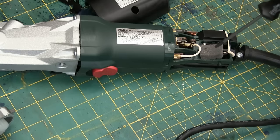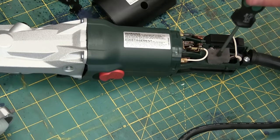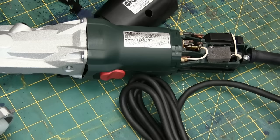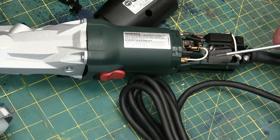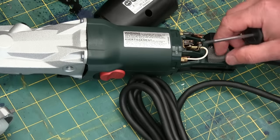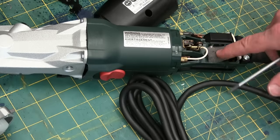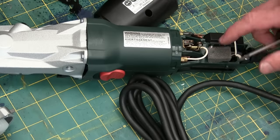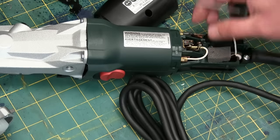This is weird though — urethane open-cell urethane foam, a little pocket of it here, just for keeping the rattle-trap effect down on the wires. But this is not very good with heat — it can't handle a lot. It's funny that it's in here right by the commutators and the brushes. This urethane is not the correct material — it's open cell, probably about 2 lb/ft³ density. It would be full of bromine, so it's flame retardant, but there's nothing to protect it from UV, from the arcing and sparking of commutation. Normal urethane is only good to about 85–100°C. It's going to get hot in here. I'd bet if this got put into service for six months, you'd open it up and it would be powder.